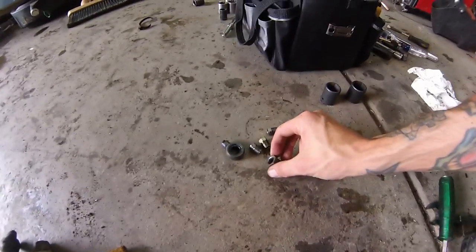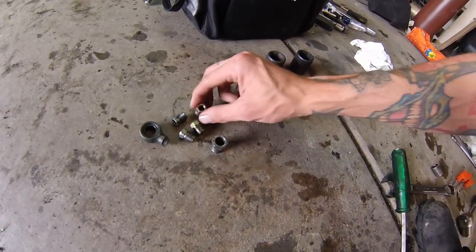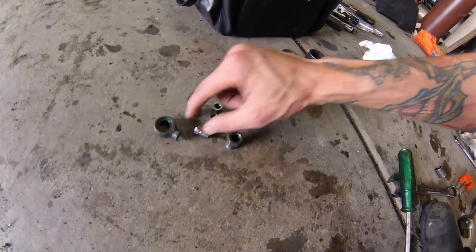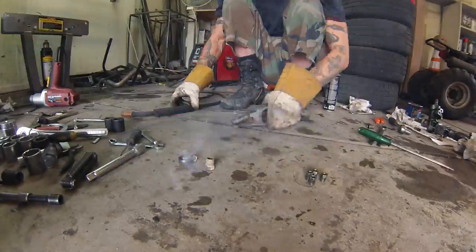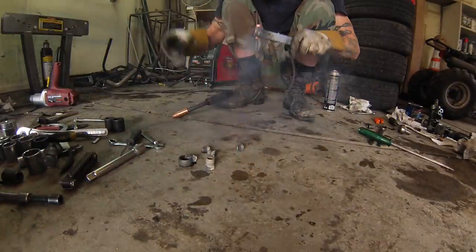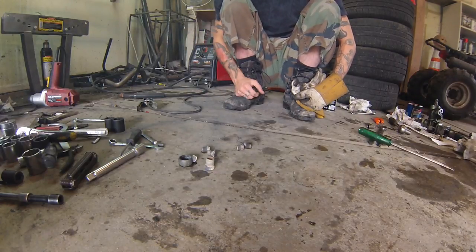I just realized there was oil from when I hit the shaft with an impact wrench to get the bottom nut off of the turnbuckle — it shot a bunch of oil out and I didn't realize it had shot all over there. Sorry if some of the scenes before this were a little hazy or blurry. What I've done is taken all the fittings off each of the hoses by cutting the flare off the end of the hose. I also cut the end of this hose and then I can put a bolt back through the hose to seal the hole off. The shaft itself isn't under pressure anymore, so you could technically just fill these with some RTV silicone. I'm going to weld them shut just because I have a welder — and then I can use them as plugs to fill in all the holes left from all the hoses. Then I'll install them into the rack.